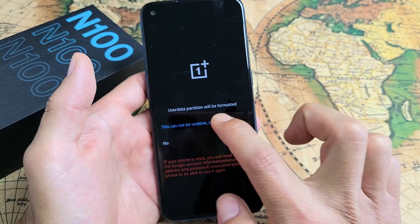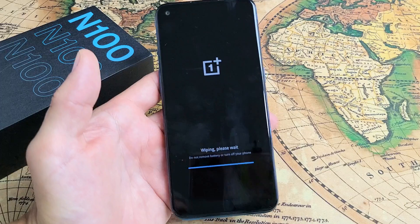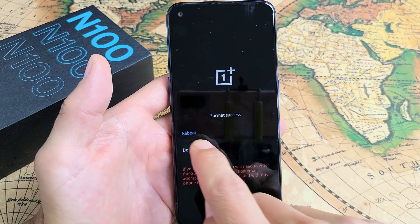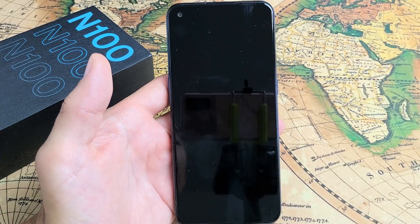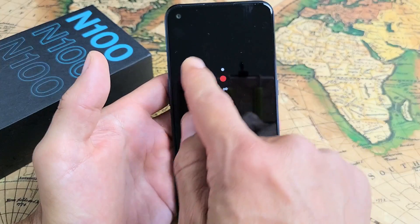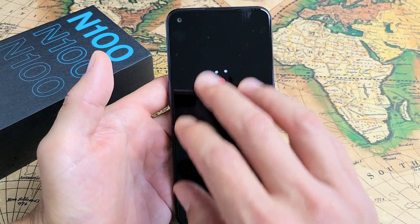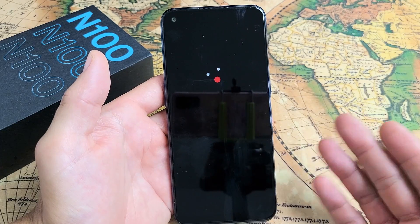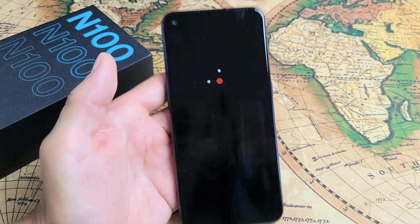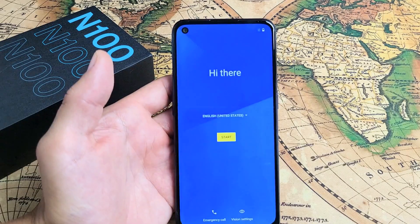So this cannot be undone. I'm going to tap Continue. Now give this one second. Wiping — please wait. Format is success. Now I'm going to go ahead and click on Reboot right here. So now basically this will be on here. You're going to have to wait about three minutes or so, and then once your phone boots up, it'll be in the beginning process where you have to choose your language and the initial setup, as if you just bought it brand new and took it out of the box. Looks like it's booting back up and voila.